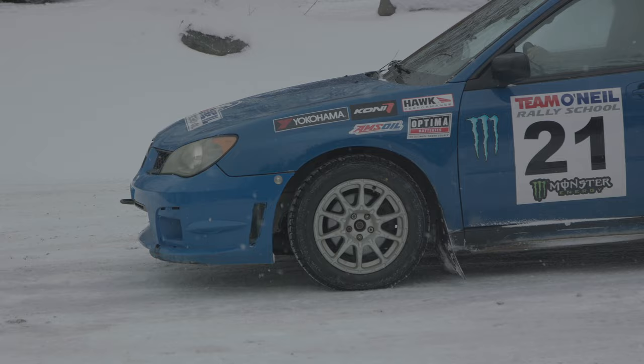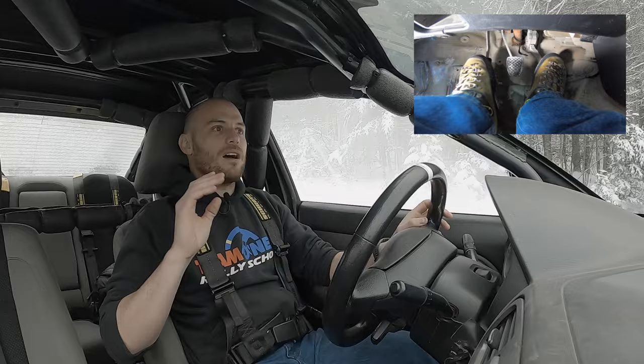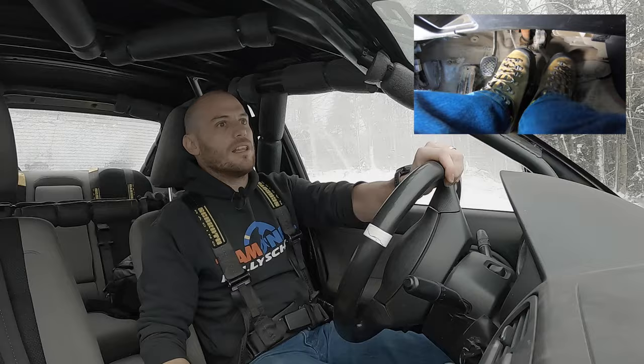The other thing you can do, in most vehicles, when you lift off the gas, you can just shift into neutral without using the clutch. In most cars it's really easy to do, and it's not hard on equipment at all to just lift and put it in neutral. Left foot brake to a stop, limo stop, and we're done. So without using the clutch, essentially, just pulling it out of gear into neutral, left foot braking, limo stop.